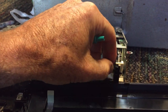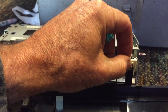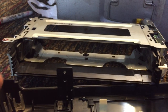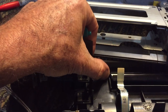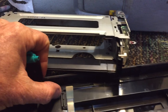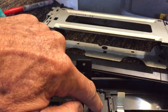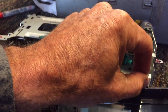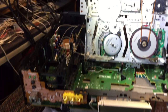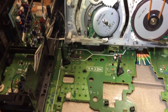Another thing to take note of is when you put it all back together — here we've got this little lever that goes up and down and moves when you push your eject button. It interacts with this little lever on the side of the door to let the door open and eject your videotape. A lot of times I put these things together too quickly and didn't take the time to line these up, and when I pushed the eject button the machine would try to eject the tape but the tape wasn't able to come out.